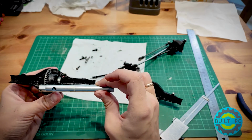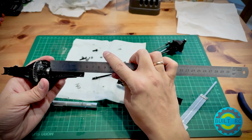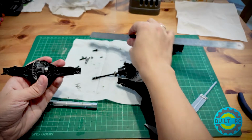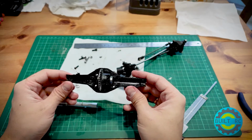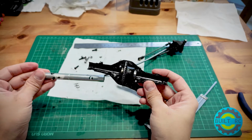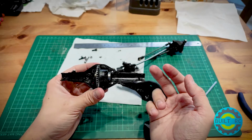After it, we will place the tube from both sides of the axle. And yes, as for the dimensions, the tube length should be like 51.5 millimeters. I will do maybe 52 millimeters. Yeah, we will have the bearing maybe go a little bit out, but it's okay in this case. So I will prepare this tube for installation in my, let's say, remote workshop, and get back to you maybe with the process or maybe even with the final result.